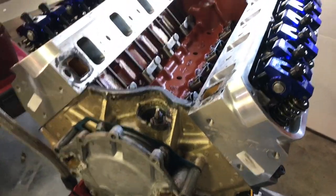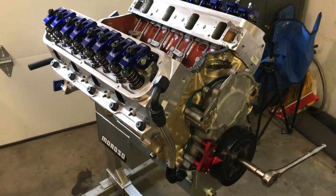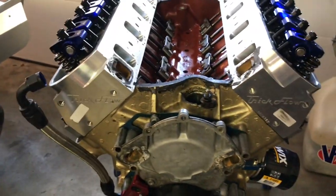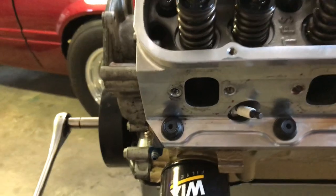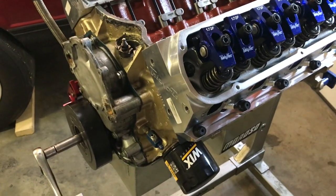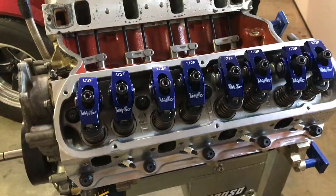I yanked the motor and I'm going to sell the engine. There's nothing wrong with it — it's a great little engine for what it is. It ran right out to 590 passes without insane boost, never split the block, and still has awesome oil pressure. But it's still just a stock-flanged output, small ports, F-cam, 150 camshaft, only 358 cubic inches. It's not going to get me where I want to go.